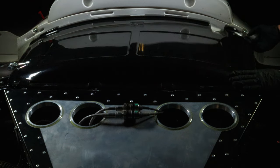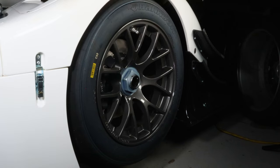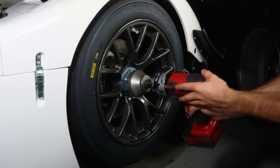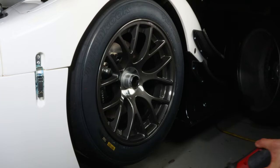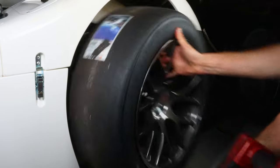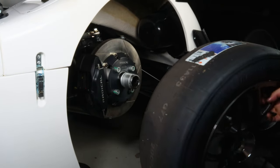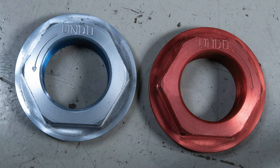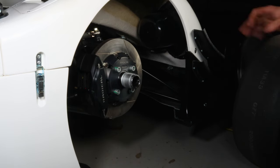Remove the pedal box cover. The next step will be removing the wheels. Begin by taking the wheel clips off each wheel and placing them on the steering column behind the steering wheel. You will obtain the impact gun with the wheel nut attachment. Taking off a wheel nut must rotate towards the rear of the car — the wheel nut has the words 'undo' with an arrow showing the direction of turn. Make sure that the gun is in the correct direction at all times, so as not to strip the wheel nut.